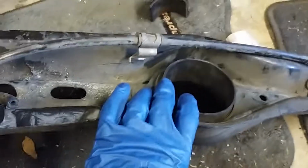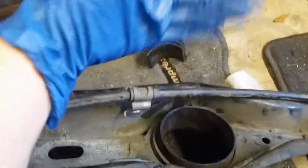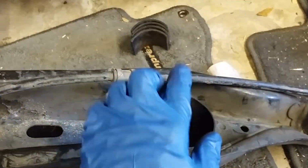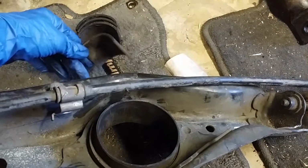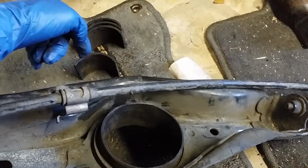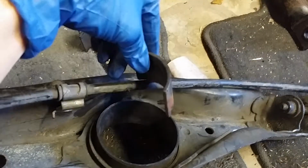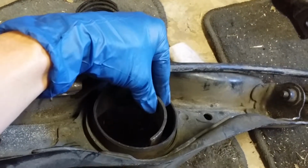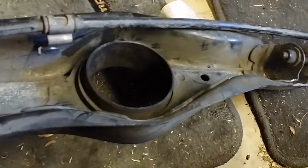And then there's this kit. When I had these out here, I had them set up on some wood to elevate them, so it was sitting like it would be if it was attached to the car, and just running a flame through the whole thing. And little by little, the best thing to do was to heat this metal piece up and just kind of work your way back and forth, and then stick a screwdriver in there and pry it against the wall, and then just let the flame travel up the back, and then just keep prying little by little, and just let the fire do the work.